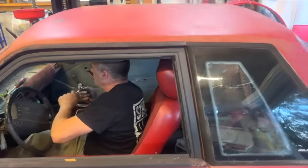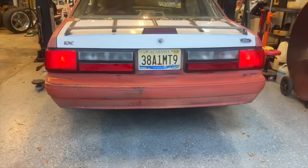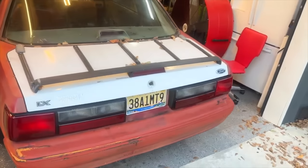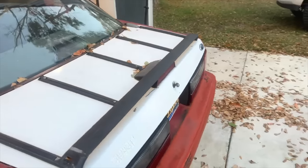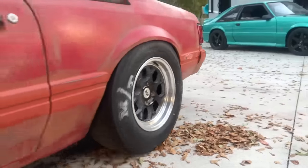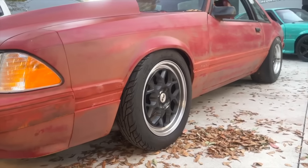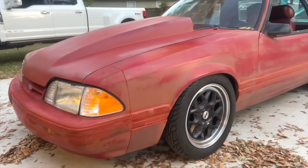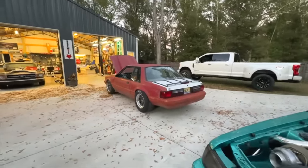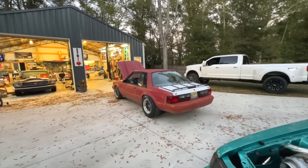I apologize for having to do a voiceover on this video — I'll throw up as many pictures as I can to help you out. These are actually harder for me to do than getting out there and showing you; the problem is I don't have a car with all the stuff taken apart. Obviously there are other options — you can put a Holley Terminator X on the car, which would work perfectly with no issues. You can still run a TPS sensor if you want to, and you can do that with the Megasquirt as well, so you can log your TPS. They make kits that'll bolt to your carburetor and you can hook up your water temp sensor so the car pulls timing if it sees a certain temperature.